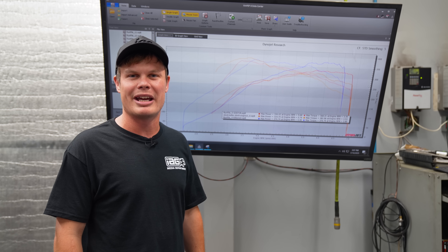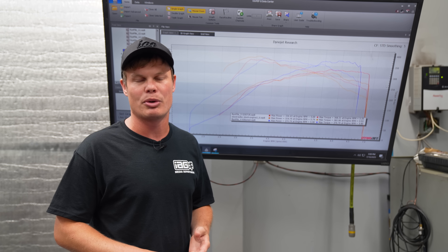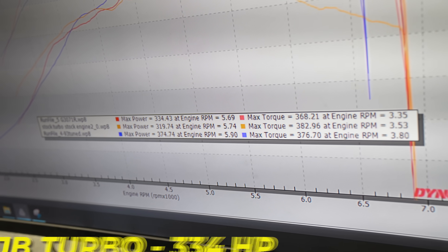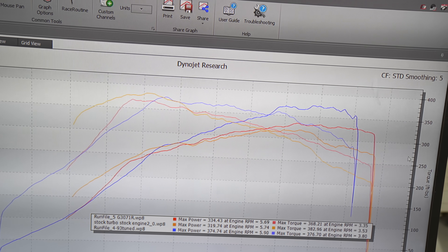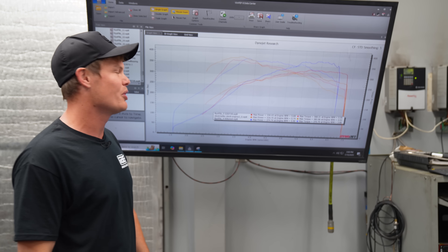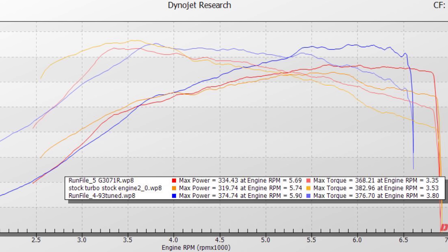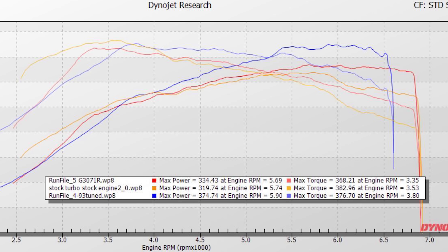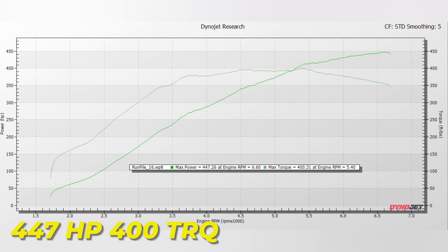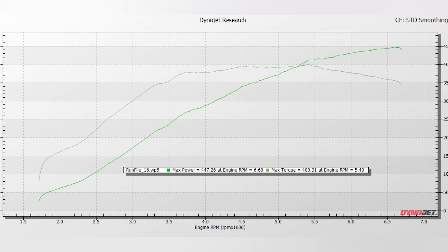That's pretty much a wrap on our dyno tune with Mike McGinnis. I've got a graph showing the difference between the ball-bearing turbo tested in this video, the stock turbo, and the journal-bearing turbo which we ended up deciding not to move forward with. The stock turbo made 320 horsepower, the journal-bearing turbo made 334 horsepower, whereas the new ball-bearing turbo made 375 horsepower on pump gas. The most impressive part is the torque curve — there's a significant improvement in the area under the curve, especially from 4,000 to 5,500 RPM. We saw the biggest power gains when we tuned the car on E60, picking up an impressive 130 horsepower over the stock turbo on similar bolt-on mods.